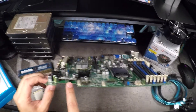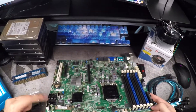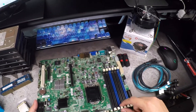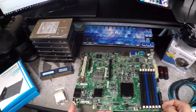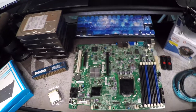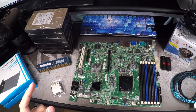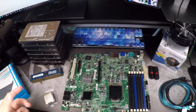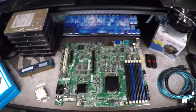This board also differs from the other one in the build guide because it has onboard SAS via a Broadcom 2008 controller. You can see the two SAS ports here, as well as six onboard SATA. This one also has six DIMMs; I believe the other one has four. We're only going to be using 12GB anyway. We're actually going to be using FreeNAS in this system, and since we have the onboard 2008, we're going to be flashing that to IT mode, which just gives direct drive access to FreeNAS. We don't want to use any hardware RAID — we're going to be using all software RAID through FreeNAS.